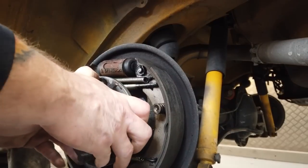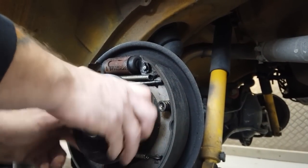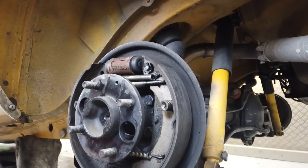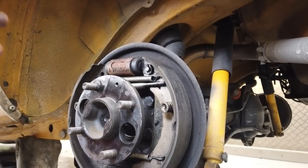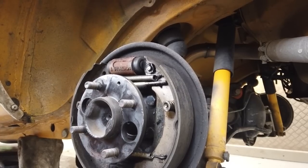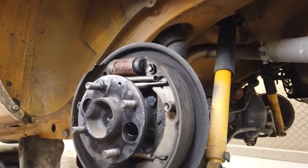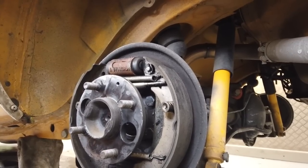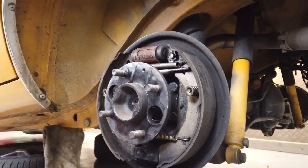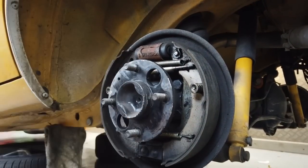Yeah. So when you lock that side or either side of the axle, you should be able to turn a wheel, yeah? Well, that's how a diff works, isn't it? If you get one wheel that's stuck, you want to rotate. That's why you can't wheel spin so much with these, because it just lights one wheel up. Whereas this is trying to light both up. So I had a limited slip diff, did I? A welded diff. I know that's your trick. That used to be my trick, welding the planet gears up, yeah.